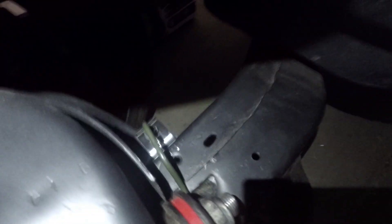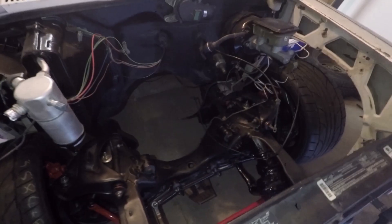My frame is hideously dirty right now, but we got the brake line plumbed to this S10 block. I used Corvette lines coming off of the calipers — those are a bubble flare type, and the S10 is an inverted flare. So what we did was buy bubble flare line that goes right into the Corvette line, then we chopped off the end, measured it, and flared it for the regular S10 inverted flare. So it should work properly now. We just got to do the other side — the process is really simple and quick and easy.